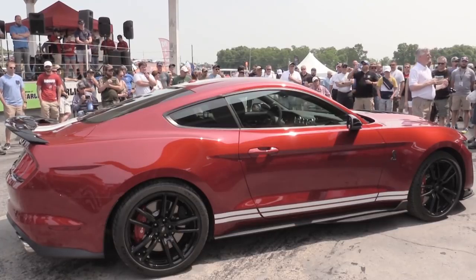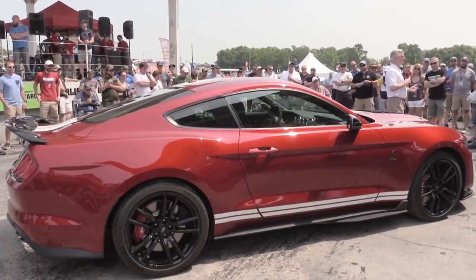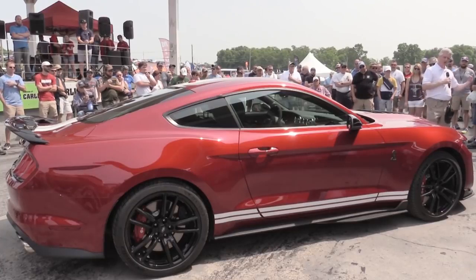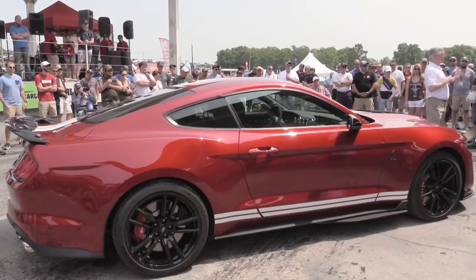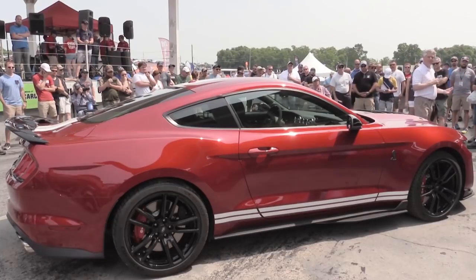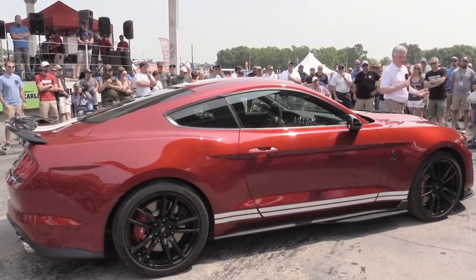We're always trying to balance that out to actually flow more air into the cooling system to keep you endurance on the track, which is also key to a Shelby, but also give you that downforce so as you go into a curve or you go over a hump, you still have confidence that that vehicle is going to hook up. And that's a lot of why we have a relatively large heat extractor on the center of the hood.